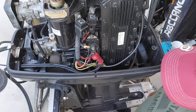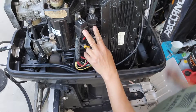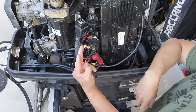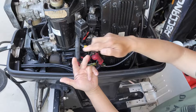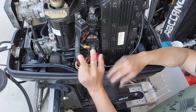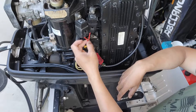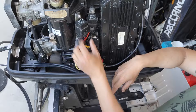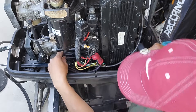For the trim switch, you'll see there are two relays in here. The function of these two relays is - because the cable from the trim is only two wires - if you change the polarity between positive and negative on those two cables they will go up, and if you flip it they will trim down. So this relay's function is just to switch the polarity between the output positive and negative.